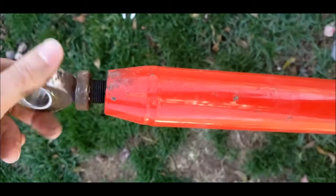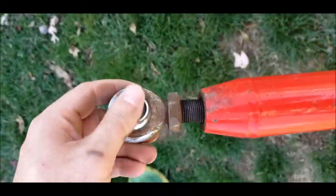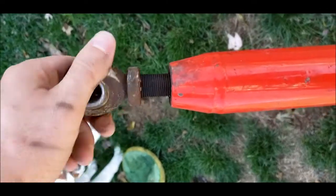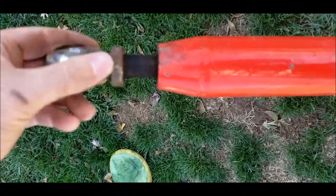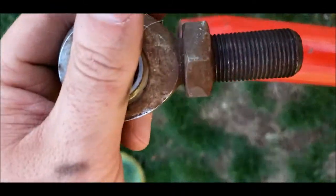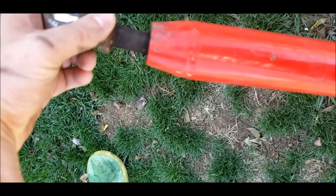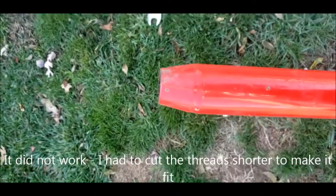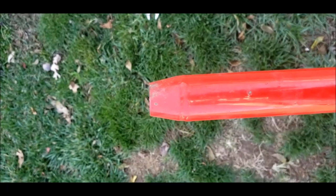So you can see you've got at least that much adjustability in the length of your track bar. Since I'm lowering my truck, I'm gonna need it to be a little bit shorter, and it was already pretty close to as short as it can be. So I don't love that, but I'm hoping that I got a little bit of play in moving this lock nut up as far as it'll go, and then putting this in to allow for the shortest track bar. It should work. This is a BD suspension track bar that came with the 3-inch lift kit, and we'll see.